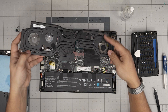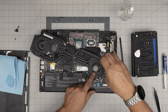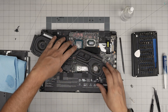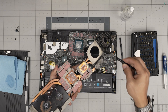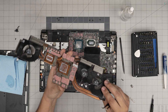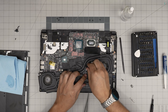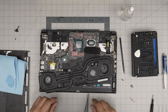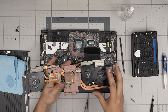To clean the fans individually, grab a Phillips zero and remove the three screws on each fan. Once removed, lift up the fan and look at all the gunk blocking the airways inside. Take it outside, dust it off, and use a toothbrush to clean it up. Do the same on the other fan — three screws on each side. These are tiny short screws. Once the fans are removed, use a toothbrush to clean the air vents thoroughly.